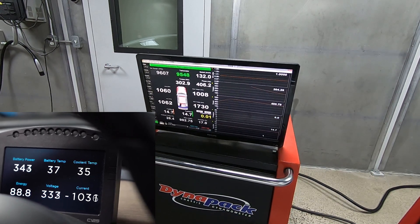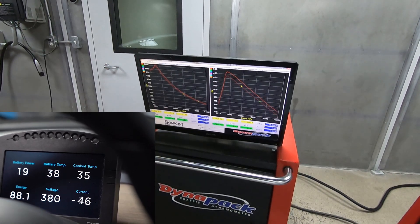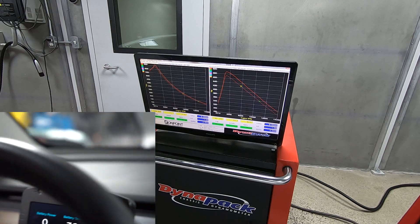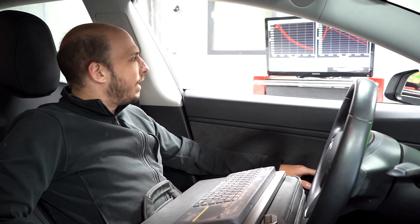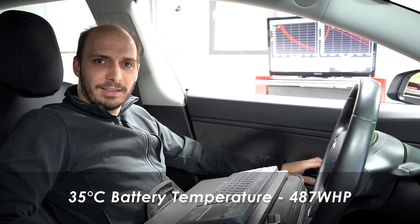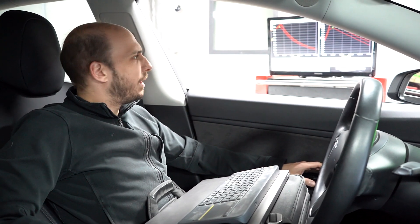Oh, that's 2090. I thought it was going to hit the limit. I won that one again. That was pull number three — we almost went over the torque limit on the dyno, just made it. Ignoring that peak, right after we were at 490 horsepower — actually 487. So that exceeded both our guesses. From 25 to 35 degrees is about 20 horsepower, and that carries all the way to 14,000 RPM.